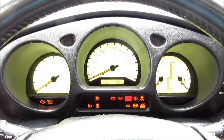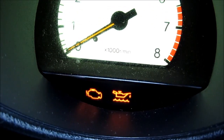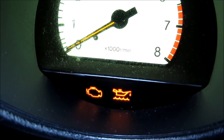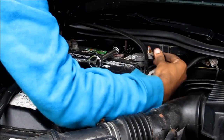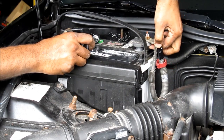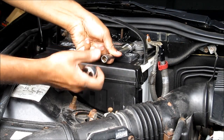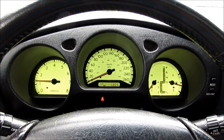Next I'm going to start the car. Due to the throttle cleaner, sometimes your engine light might be on when you start. To reset the check engine light, I'm just going to loosen and remove the battery terminal for a couple of minutes. Five minutes later I'm going to replace the battery terminal and tighten that up. Finally, you're going to want to take the car for a nice long drive so it relearns your driving style.